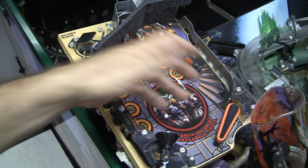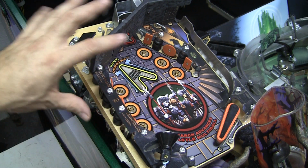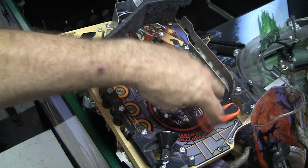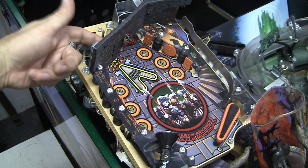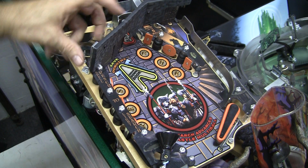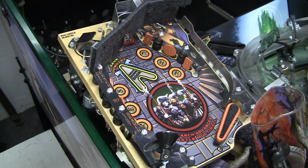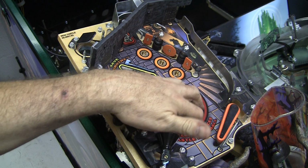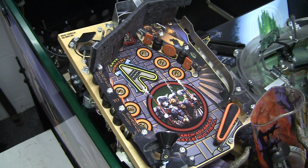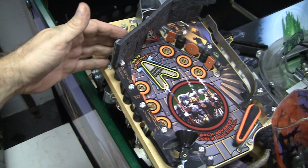In this case, not only are you putting wear and tear on the flippers, but I'm running into a weird anomaly because of the design of the game. Every time this flipper would go off, it would create a vibration that would trigger the switch up here, because the switch is very, very tightly set. See how sensitive it is? Tick, tick. If you just put a little bit of pressure on that door, that switch goes off. So vibrations up here were triggering the switch, and it made the game largely unplayable. And this is not something that I've found is easily adjustable either.